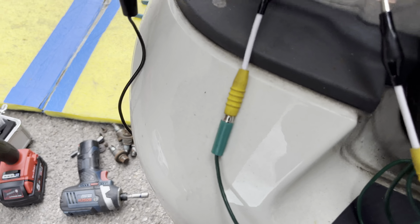So I know from here all the way back to the ABS module is good — that's a very fast test. You can see the rotation, which would actually simulate the wheel spinning. That's how these pinpoint testers work. Once you switch it off, off it goes. All I need to do now is resolder, sleeve it, put it all back — job done. Thank you for watching.